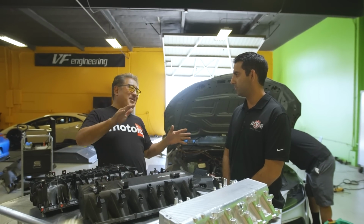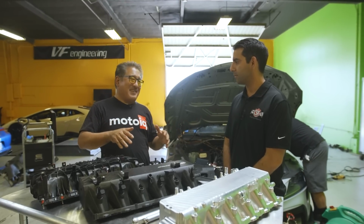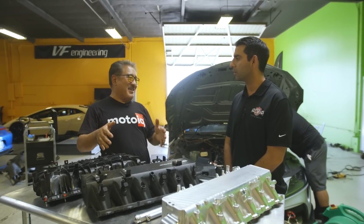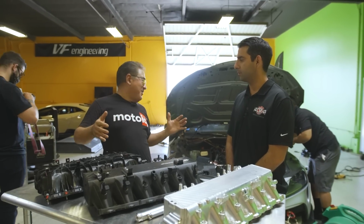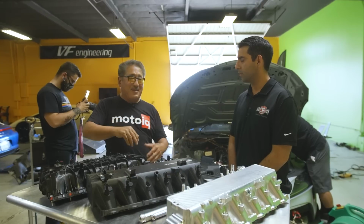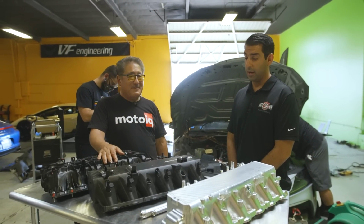With all that, let me qualify that a little. I've seen water-to-air ones that create a bigger delta across the core, but of course those were drag race or our Bonneville car where we had no space constraints, so we had a huge core and ice tanks and huge heat exchangers. But considering that this all fits within the OEM space, it's highly efficient, and I'm really impressed with the results. And thanks, Mike.